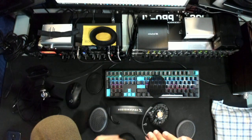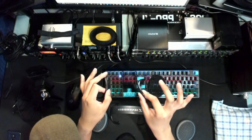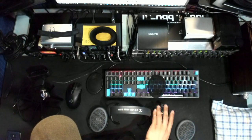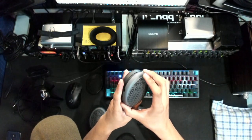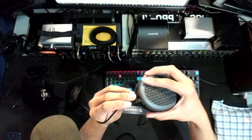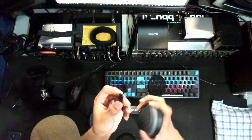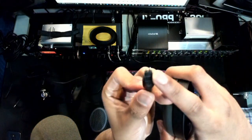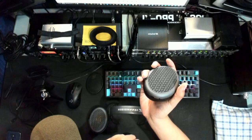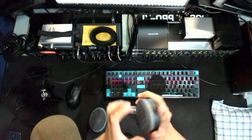So typically, either you have to find the original cable that came with the 580s, or the early runs of the 600, or you can just take this out. That's a little easier, a little cheaper, and then you get your cup. You don't add that plastic part in, and then this part here will be exposed completely, allowing you to put the new plugs in. So if you ever have a pair of newer proprietary plugs, because these are proprietary, it's like 2 pins on both the left and right side. One's smaller, one's bigger. If you ever have a 580 and you have that issue where the newer plug doesn't fit inside the old thing, just take the dingus out and you're fine.